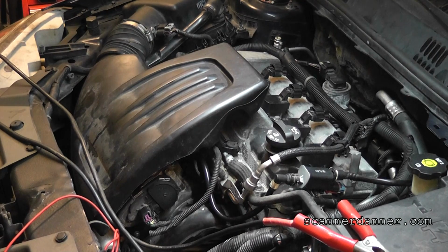So just so you guys know what's going on, all it has is the fuel gauge, the RPMs, and the miles per hour. But RPMs are not functioning. So we have no tachometer signal. And we're running longer than we were before now. No tach. I don't like the crank sensor circuit.